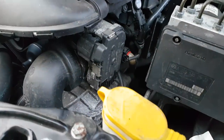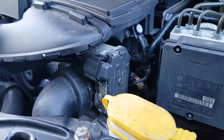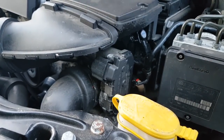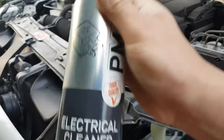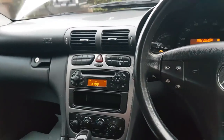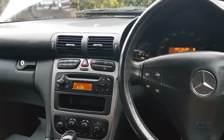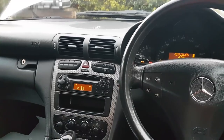When I started to inspect the engine I could hear a sort of vacuum leak coming from somewhere around there. I sprayed some electrical cleaner on it - which is just normal electrical cleaner - and when I spray it you can hear the engine RPM change. So we're going to have to inspect that area and figure out what is wrong in there.